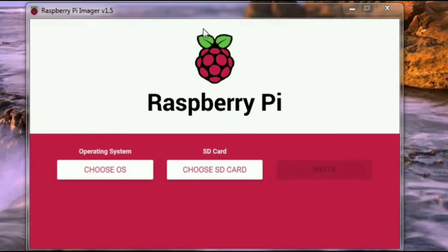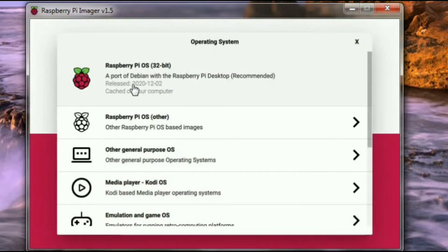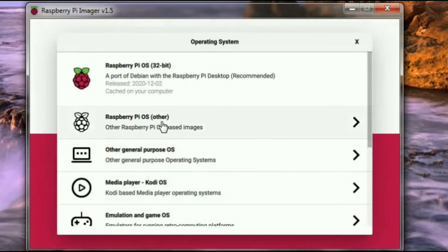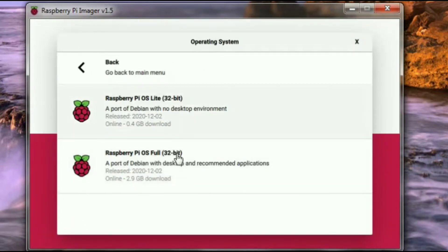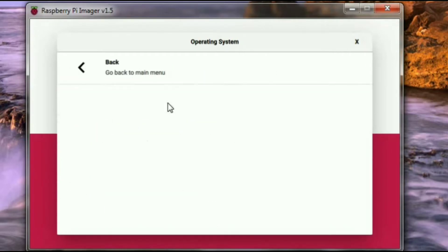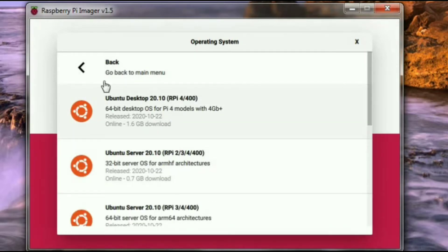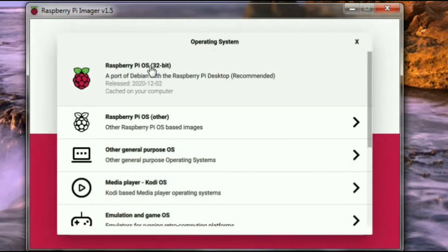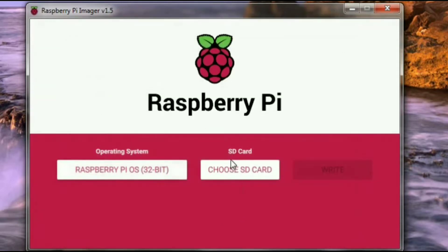As you can see, this is the Raspberry Pi Imager tool. Click on the 'Choose' option. Here you can choose from many OS options provided by Raspberry Pi Imager — you can see Ubuntu and many more. Since the Pi Zero is not for heavy processing, we will choose Raspbian OS 32-bit.